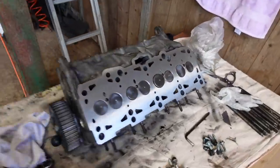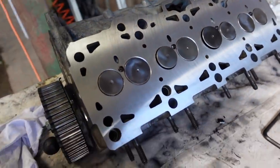I don't think I've mentioned this in any other video. When I took it off, I couldn't see anything wrong. Took it to be sorted at Ward's Engineering, which was the last video, and he confirmed what a few guys in the comments had said, which was that the head gasket had gone between cylinder 2 and the water jacket. Head's been off, done, all sorted. Now, I've just picked it up this morning. So, here is the new remachined head.